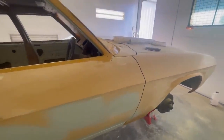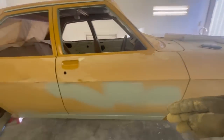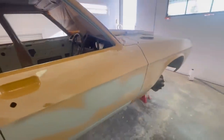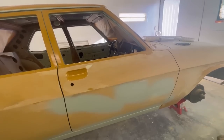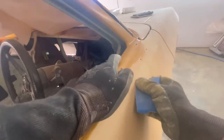I've given this top side of these panels a bit of a rub - the top of the door, the guard, a little bit on the bonnet - and chopped in my body line, so the reverse curve. Got a little bit of a light spot here in the middle but I think because I'm going to re-prime this I'm just going to leave that one. These spots here might just get a little bit of filler now - because if I go and try and wipe some filler into this even though it is very shallow I might end up losing that body line, so I think it's better to just put a few more coats of the Resto Finish Poly Primer on it and block out that repair. But these ones I'll put some filler in, so I'll just give those areas a little bit of a chop up with some 120, and put a little circle around them so I can see where they are and don't lose where I'm going to put my filler.